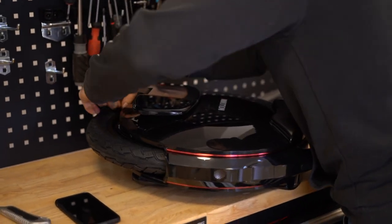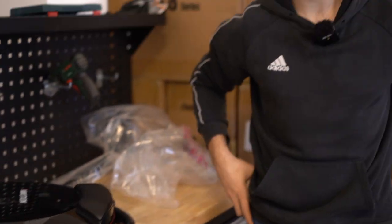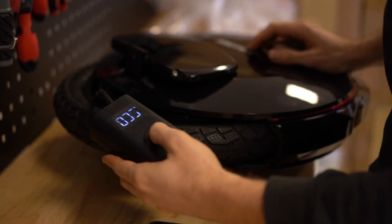The heavier you are, the higher the pressure you need. If you have a smaller wheel — for example, a 16 by 2.125 — you'll need a higher pressure than if you have an 18-inch wheel or a wider 16-inch tire. It also takes some trial and error. With higher pressure the wheel will tend to track and might feel less stable, but it's better for jumps, going downstairs, and hitting curbs. With lower pressure you'll have more comfort but it'll be easier to damage the rim. Here I see it's 27 PSI; I'll pump it up to about 35.